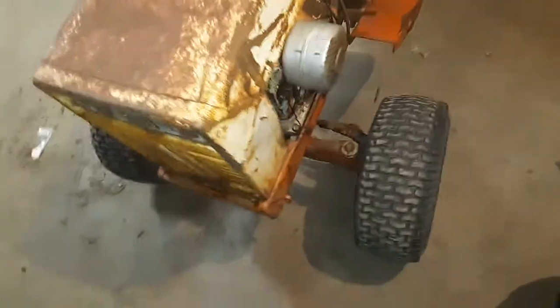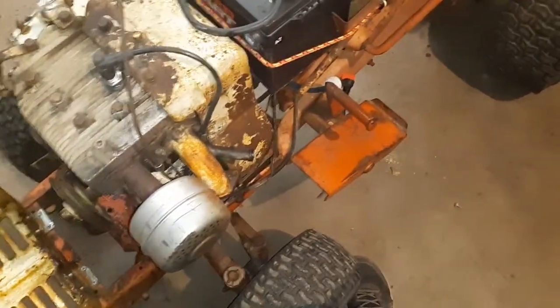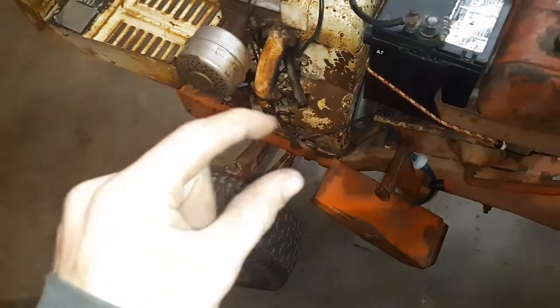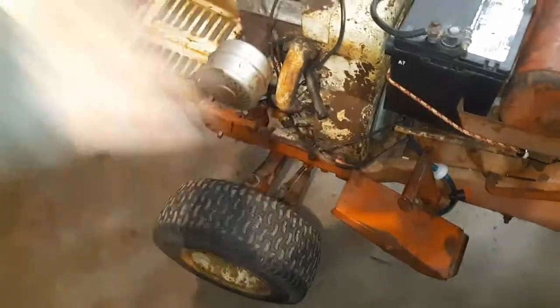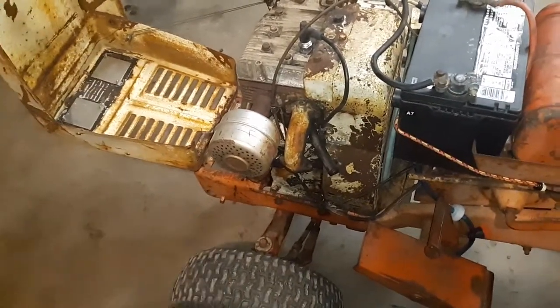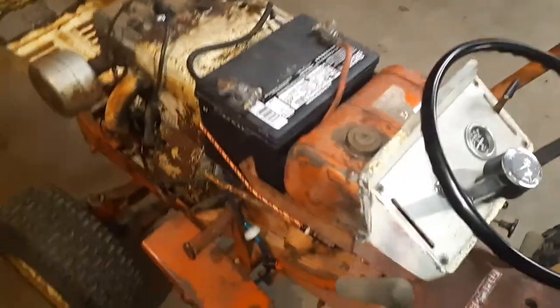I put a normal muffler on it. The hood is not in great shape, but if I decide to restore this unit I have some spare hoods in my shed I could use. We put a big car battery in it. The problem was it was running like crap — I took the carb apart and on these Briggs engines they have a jet in the carburetor, about a quarter inch long, and it was just corroded bad from ethanol and it broke. So I went on eBay and found a carburetor for $31 — it's a generic brand but a brand new bolt-on carburetor for this unit.